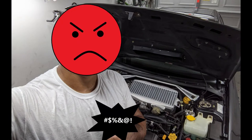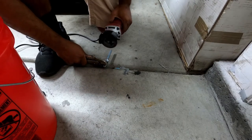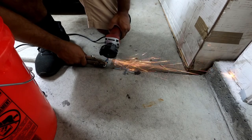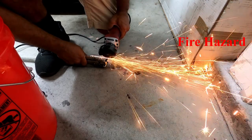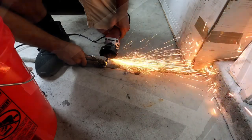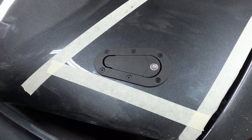After confirming the lock works properly — we're done right? Nope. Now that my anchor height and orientation is set, I have to cut the excess threads off the anchor so I can put my headlights back in. I used my larger cutting wheel to make that happen pretty easily, then I reinstall the anchor, and now that side is complete.